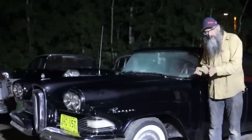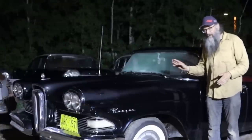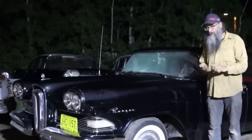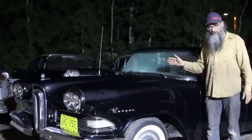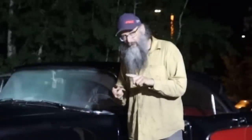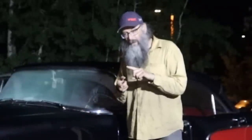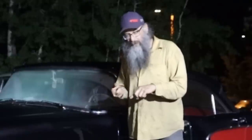You could just barely feel that it was pulling, and I think that's what was happening. The car was running, it was just enough to run the car, but if it got hot, if you let it sit, if it was low on fuel, it just wouldn't feed and it would starve the thing out. It would lean out and shut off. It was moving the little finger that runs the pump, but it wasn't moving it down into the part of the travel where it actually pumped.